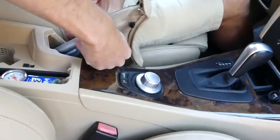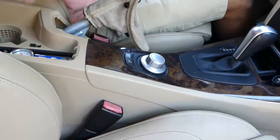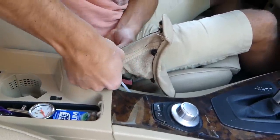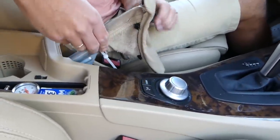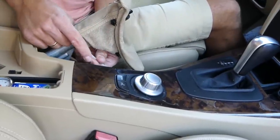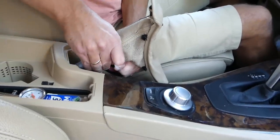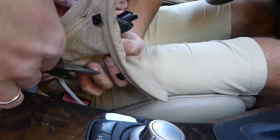You need to put it inside out, get it over the brake, and pass the canal here on the bottom side as well. Now we need to install the zip tie. On the very bottom it has only one canal that it goes into. Align everything carefully to make sure everything is in. It needs to be towards the bottom — it's getting more tight.